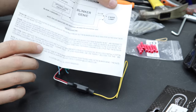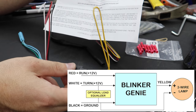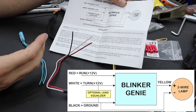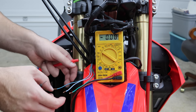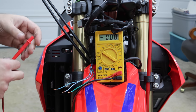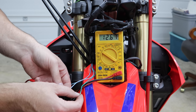The Blinker Genie is going to connect to our three wires — the wiring diagrams are right here, it's not too complicated. It's going to make it so the light stays on. When we're not using our turn signal, it'll just be solidly on; when we use the turn signal, instead of flashing on it'll flash off, but it'll have the same effect as a blinking light. It's on 12 volts DC. Let's make sure the real wires aren't touching anything and turn the key on. I'm going to bet the solid wire is going to be the running light, and the striped one is the blinker.